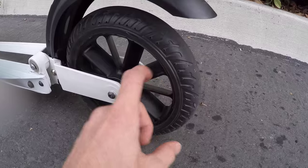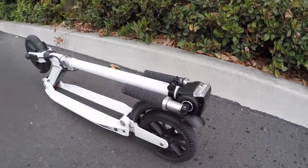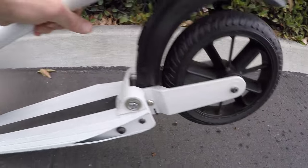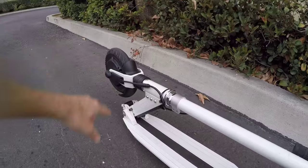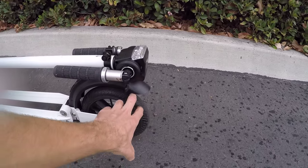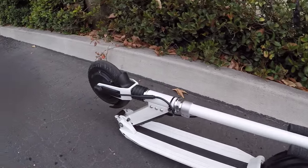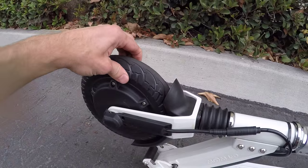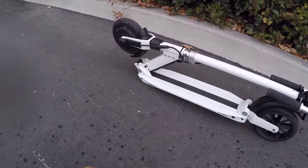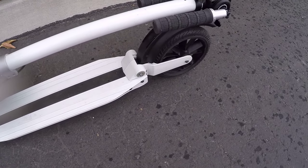Down here are the plastic ET Wow wheels. On the front it's solid because that's where the 500-watt gearless direct-drive motor is. On the back there's a nice thin wheel. This is very front-heavy — all the weight is in that front wheel, whereas on some other kick scooters it's in the back. The tires don't have air in them, which means they won't get punctured or go flat even over glass. They're not quite as forgiving, but that's where the suspension comes in. In my time riding it, it actually feels pretty good and not too uncomfortable, which is important for longer distances.